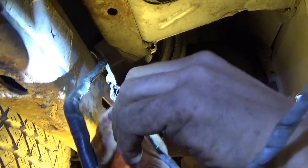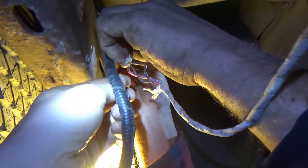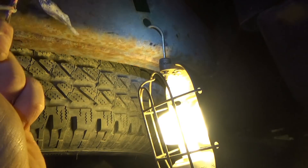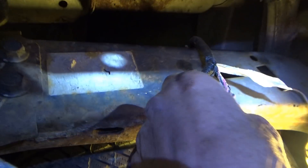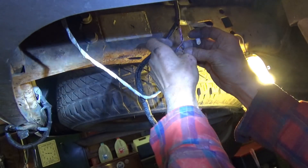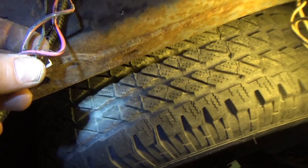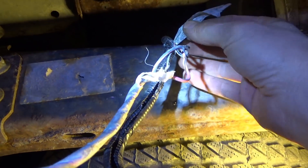That's unbelievable — it's all salty and corroded in there. There it is. There must be a break in the insulation right in the pink and black wire. Lights out. If I pull on that — look at this. The bare wire was touching the sheath. See these bare metal strands? If you touch them to that — that's crazy. How did that rub a little hole right there inside the sheathing without hurting the sheathing? It's like the insulation rotted inside it. Salt erosion ate the insulation. This is all salt.